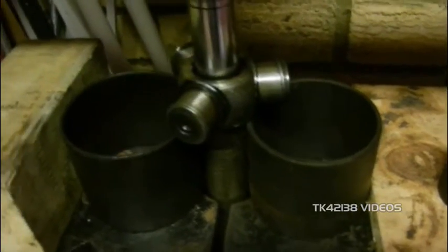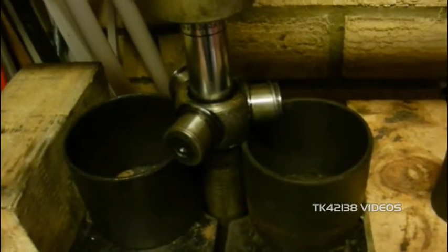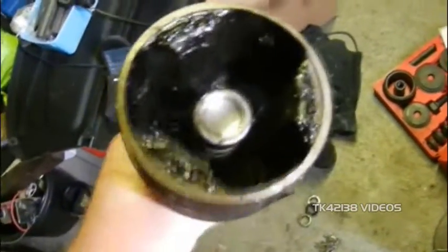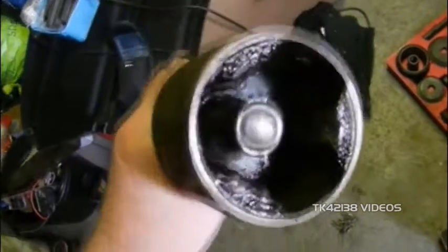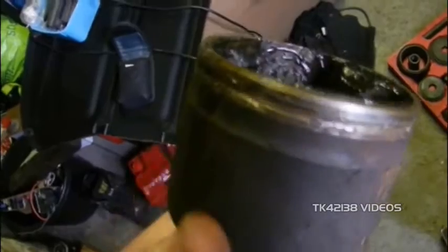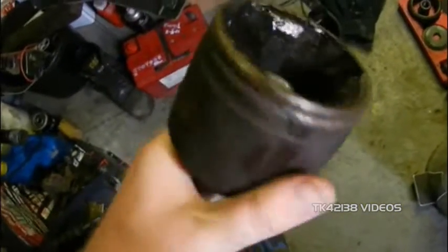There's another reason why the shafts on the automatic gearbox XMs are a little bit more tricky to do, and this is the reason why. This is the outer casing of the inner joint — you can see the big spring in the middle. Normally when you take the rubber boot off, this joint just slides out, but on the automatic, Citroen decided to put this on.